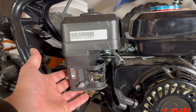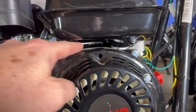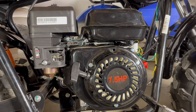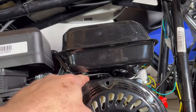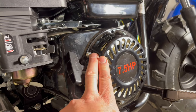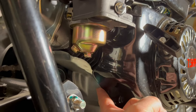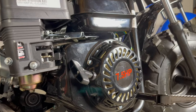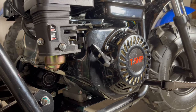This is the air filter and carburetor, and it can be replaced with a more responsive slide carburetor. This arm is connected to a governor down inside the engine, which keeps it from going too fast and destroying itself. Some people remove the governor from inside the engine or put a zip tie here to defeat it, but that's a dangerous way to go. If you're going to remove your governor, you really should get a high-speed flywheel that won't destroy your coil, a high-speed rod that won't break and come through your engine case, and stiffer valve springs so you don't get valve float. Sometimes you can get lucky just deleting the governor, but many times you don't — I've seen it and destroyed engines myself.